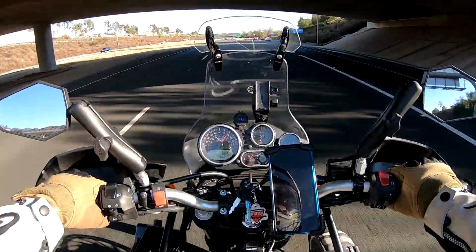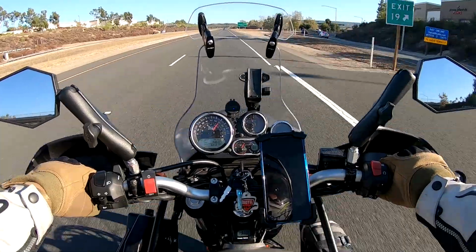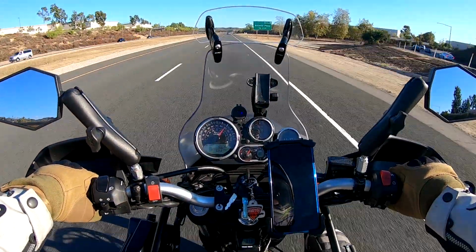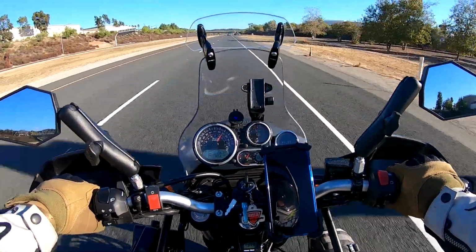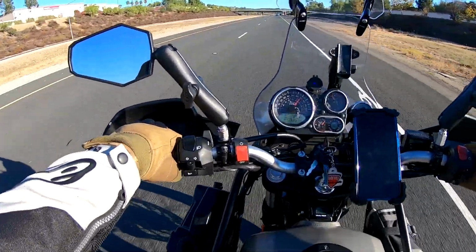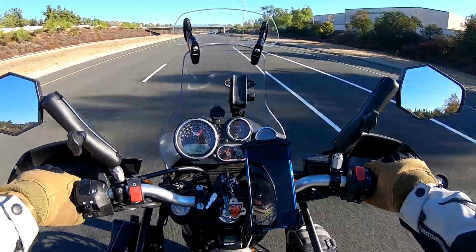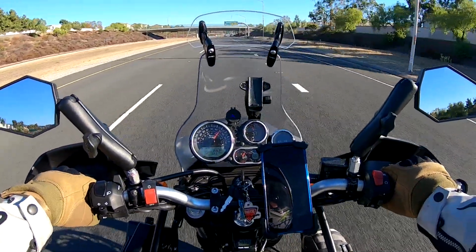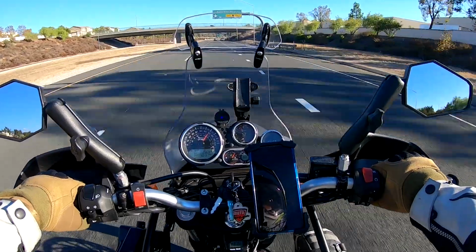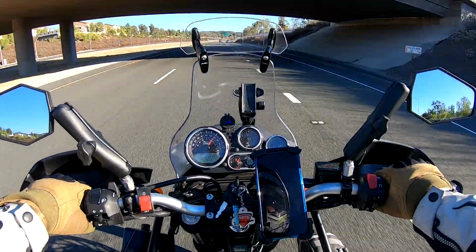This Hagon rear shock. Man, I struggle with that. I could blame a long day at work, but I'm not going to. Anyway, I have the damping set in the middle. It has 5 turns, I believe, from max to minimum, and I set it at 2.5, and it feels pretty good. This morning, when it was cooler, it might have felt a little harsh.